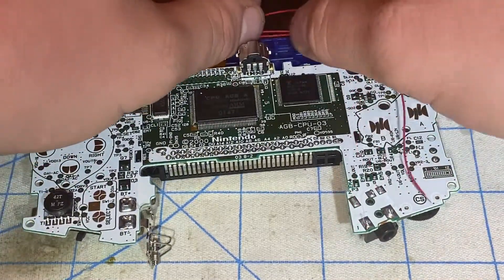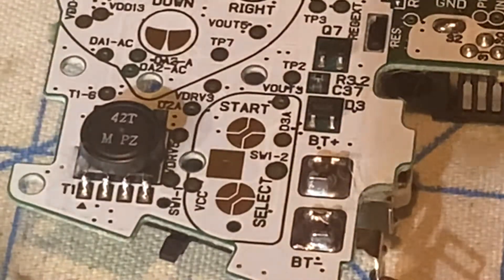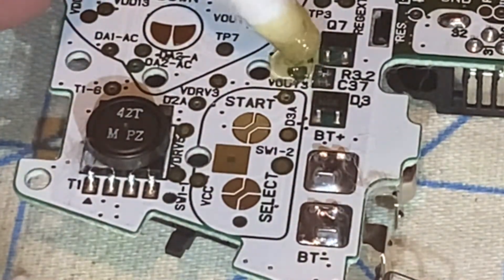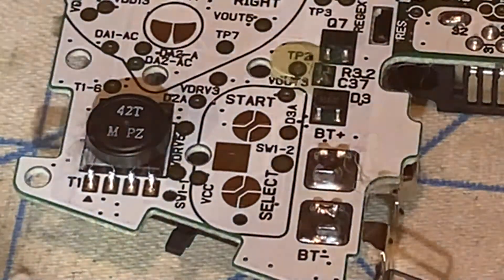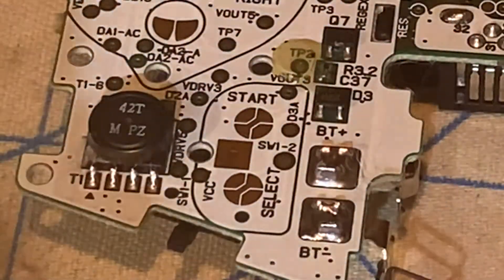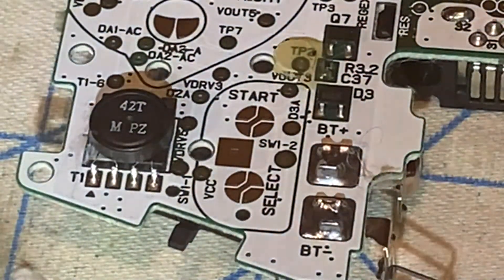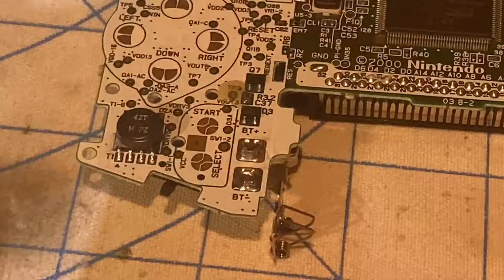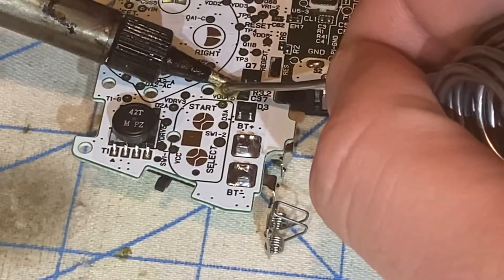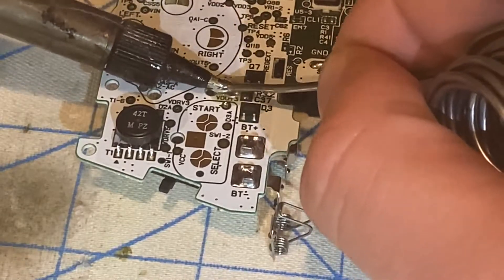While I'm waiting for the soldering iron to warm up, I'll explain the wiring. I'm going to apply some flux on the TP2 pad and then use solder to put solder on this point where the flux is. After I solder the wire into that point, I'm going to use isopropyl alcohol to clean it. Now I'll use solder to pre-tin the TP2 point with my solder and iron.